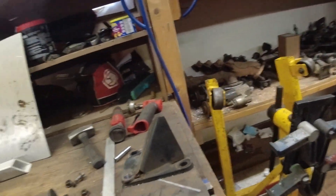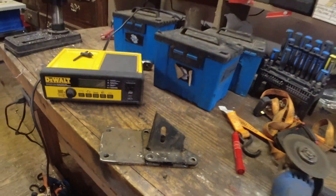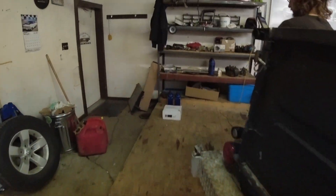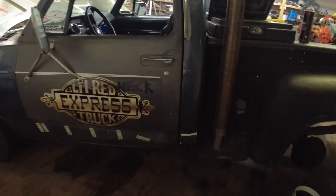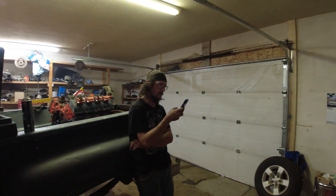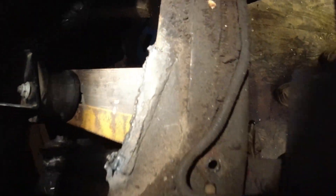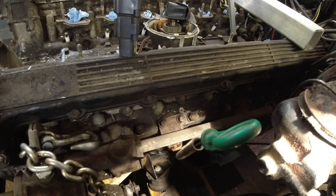There we have the mount welded on — not fully welded and ground down or anything, we're just test fitting. It's going to come out at least once more so we're just letting them cool. Then we'll get them thrown on the sides of the engine. We've got some three inch channel iron with holes drilled and a slotted hole in the end, cut at angles so it sits on the frame here. Steven's going to get it welded in — not all the way, just enough to hold the engine for now. When we pull things back out we can weld it up better and put in a little bracing where we feel we need it.